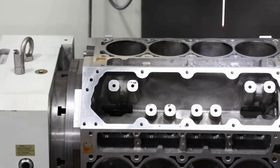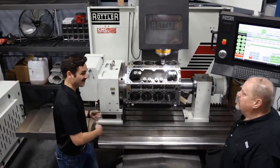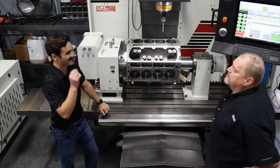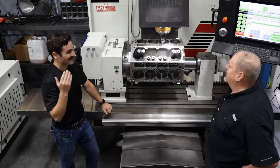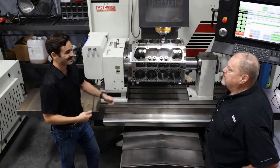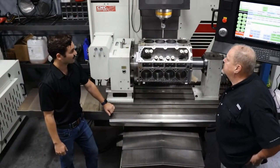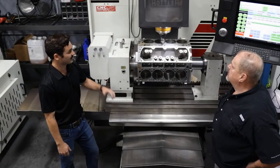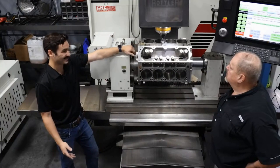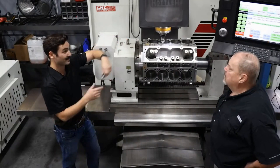With manual equipment and manual machines, as an operator you're very focused on where this thing is going — which way do I turn this, that feel. With CNC, you're looking at numbers on the screen — you're so focused on the theory and the application that you go, 'what am I even doing?' But that's the beauty of it: you have intuitive software, a machine that assists you and alleviates those mundane tasks, so you can have these conversations and focus on what you're actually creating. So the process here — picking up that dowel pin hole, we zero out, we let this thing probe, and we'll see in a moment how different these locations are compared. Then we have the ability to correct and move things, assuming we have material, and that's why we want to put these sleeves in.